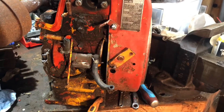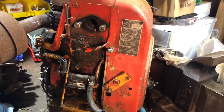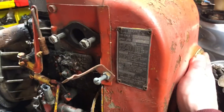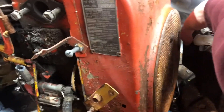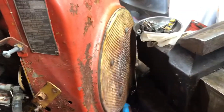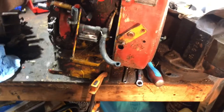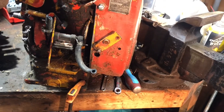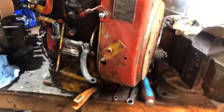Slowly working, salvaging off what I need. I want to see what the cylinder looks like, but that's all for today — it's New Year's Eve. As you can tell, there's definitely a blown rod on this where this spins, just like the other one. There's no resistance, no compression or nothing. At some point I'll have two semi-assembled 10 horsepower Kohlers.